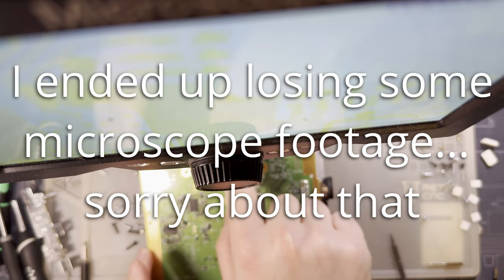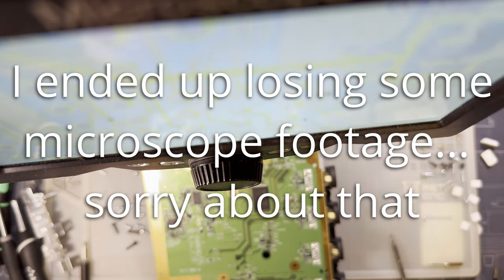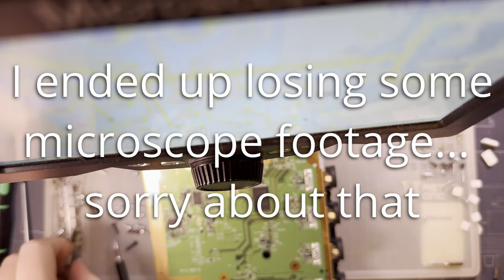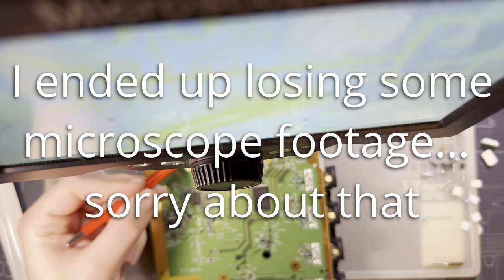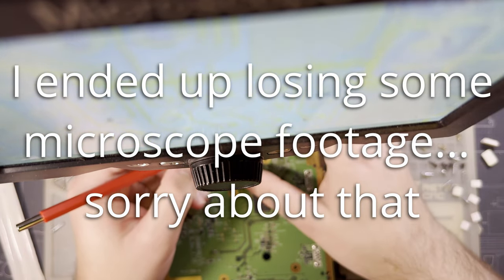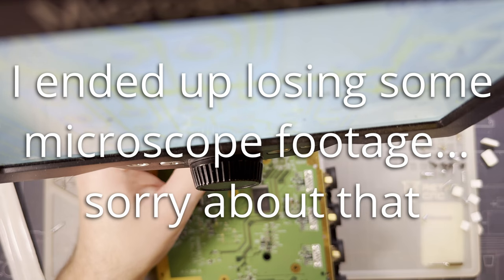So here is the RVL chip. I'm going to be soldering to this set of vias right underneath it. I'm going to be using my little fiberglass scratch pen to prepare these vias. I would prefer to only prepare the ones that need getting soldered to, but I don't think that's going to work. I also wish I could make that picture a little bit bigger.